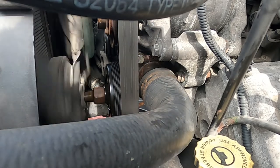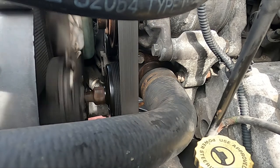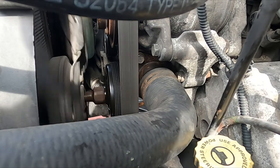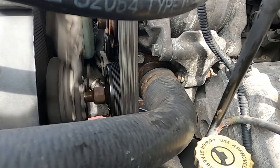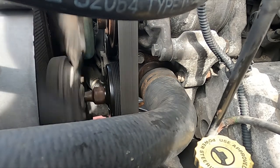We're going to get into taking this thermostat out today in this episode. It's dripping on the bottom — I did the water pump yesterday. We're going to get this thing moved into some shade, cool this thermostat housing off, check the thermostat, clean the surface, put it back in, see if it stops dripping. If it doesn't, we'll go buy a new thermostat, put it in, and be good to go.